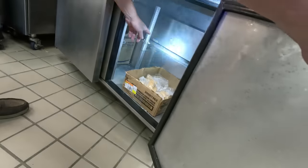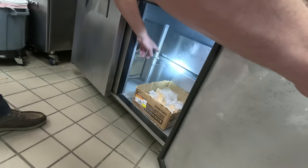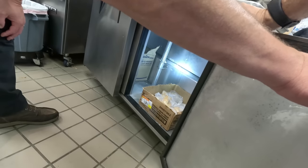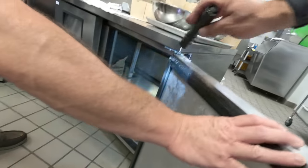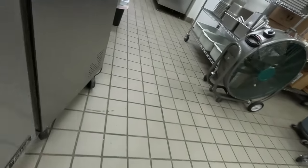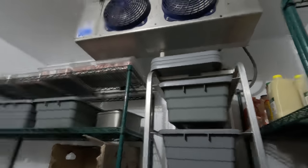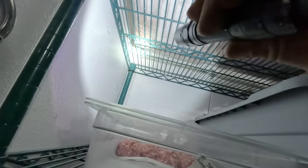We're going to have to put it into a defrost to get it to liquefy, then see if we can get it to drain out — chances are it's probably frozen. What was it leaking out of the bottom of the pan here? That looks like ice buildup. Okay, so it goes from that cooler right into a freezer — that's not a good idea.